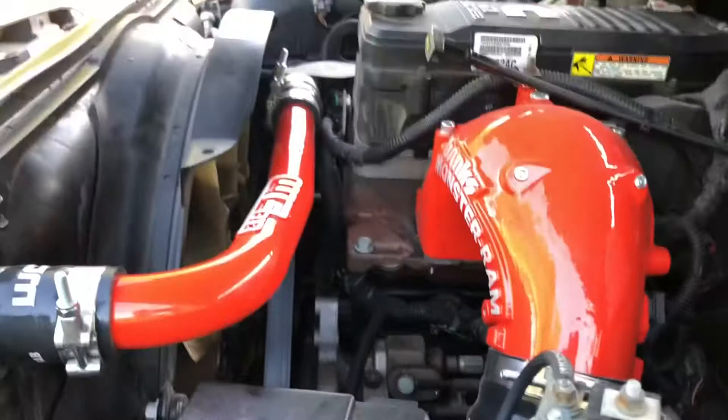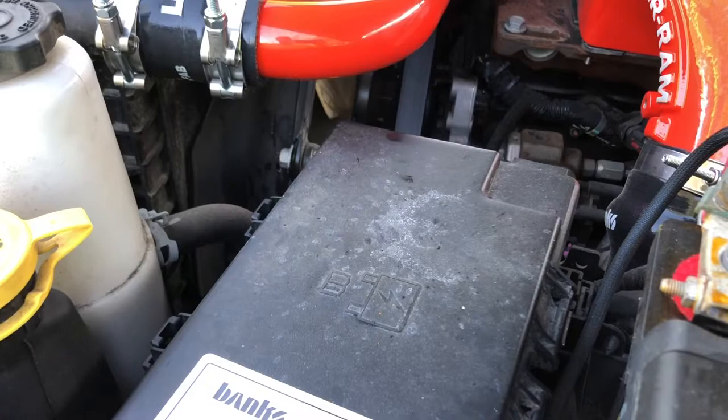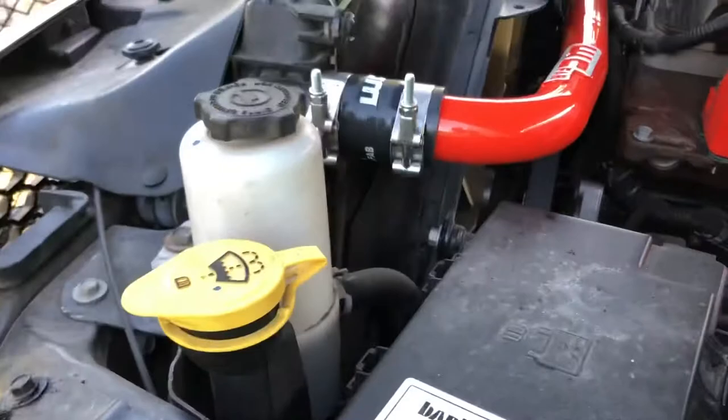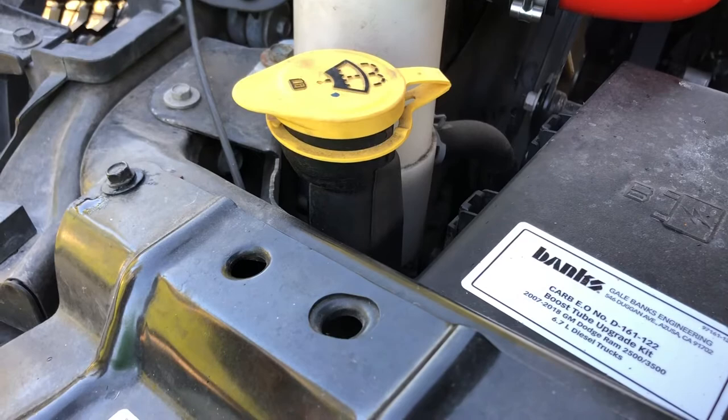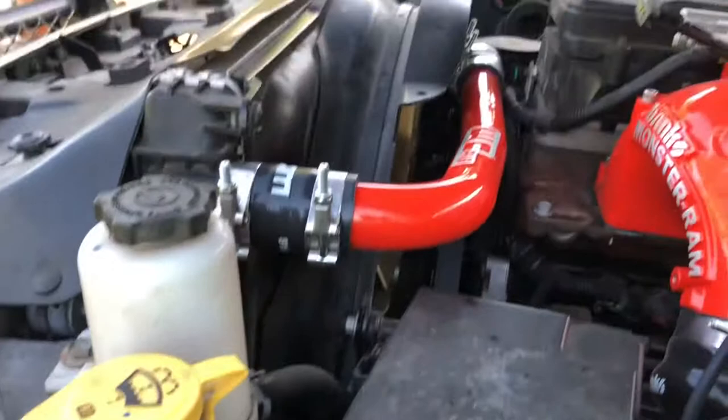It's gonna be a mess either way. I put cardboard on the ground to soak up most of it and didn't lose that much coolant — didn't have to add much back. You can drain the entire radiator per the instructions, but on these Dodges and Rams, like with the oil filter, everything drains on top of something else and just goes everywhere.